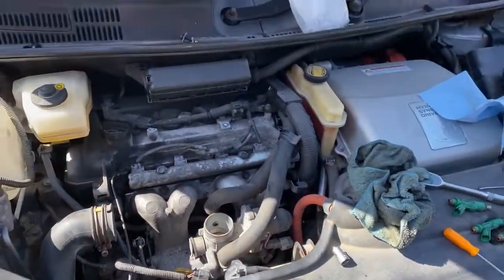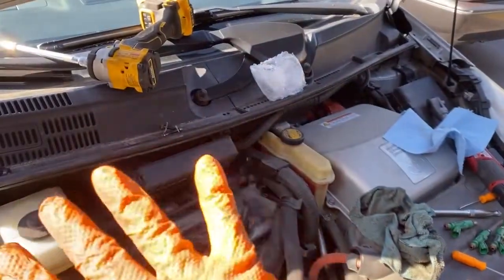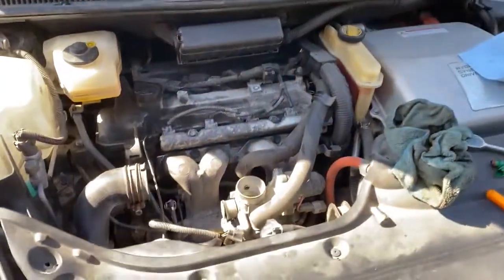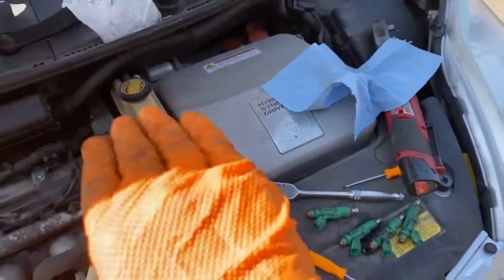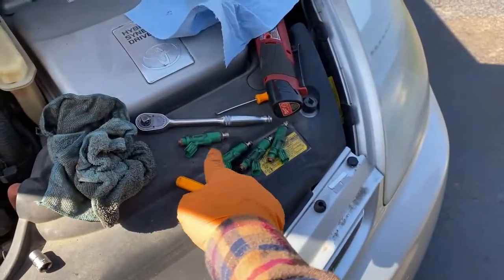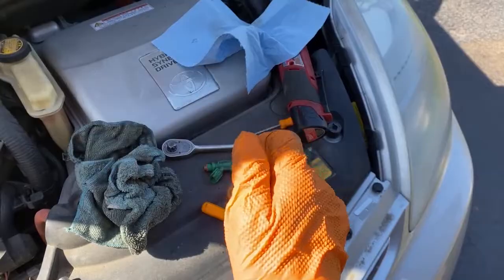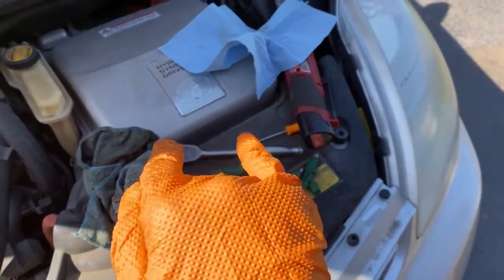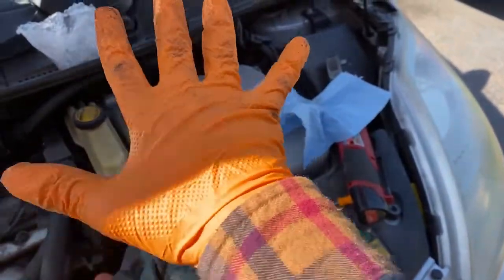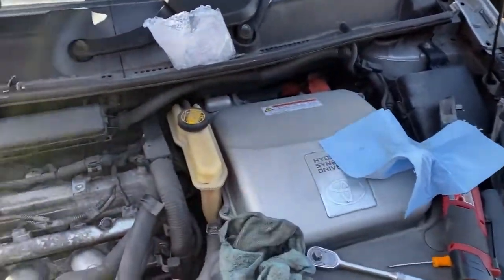And then when you start it, by the way, you're probably going to have a bunch of misfires and stuff like that. Once it levels out a little bit, give it some gas and see if it persists. But the thing with these injectors, they're supposed to have like a fan of fuel come out of them. I've actually hooked these up to cans of carburetor cleaner and powered them under pressure, and saw the old ones are like this weak little fork stream versus a new one, which is like a fan like this, you know what I mean, versus just right.